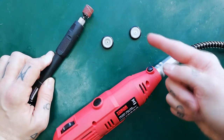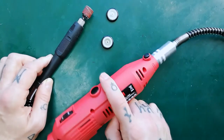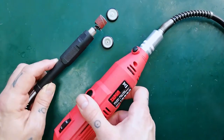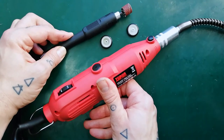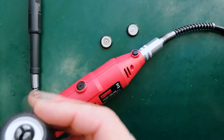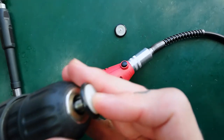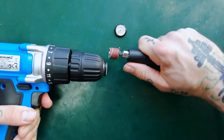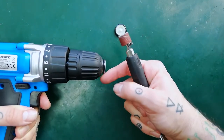So here's how I go about evenly filing down the rubber o-rings on these idler wheels. First I need some kind of craft tool that will accept a sanding head — I could use a Dremel, I've got this relatively cheap one, about £25 off eBay, works fine. Then the other thing I'm using is another tool with a chuck big enough to hold the wheel. This one makes the sanding happen rapidly, and this one makes sure that the amount you're sanding is even all the way round.